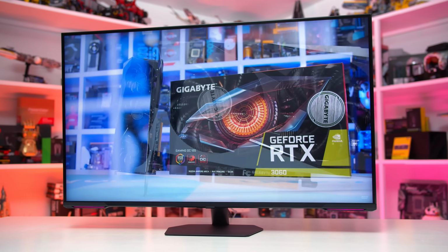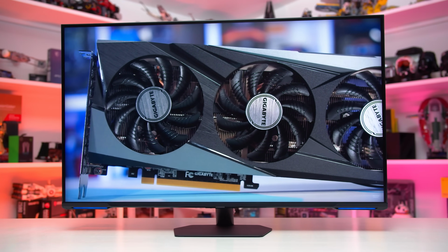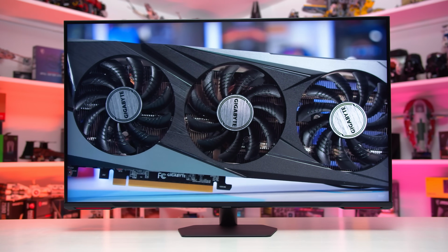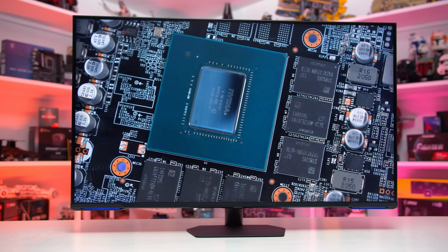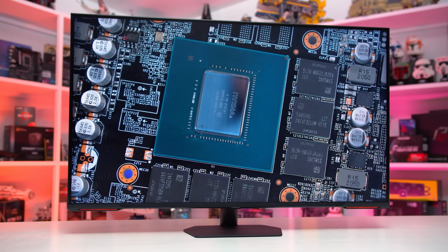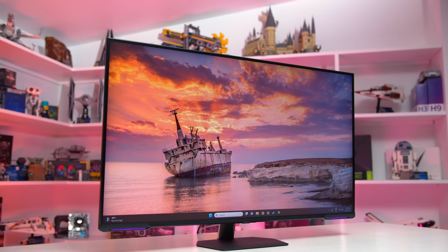The LS43 is much more usable as a monitor for desktop apps with 100% display scaling in comparison to WOLED panels at this size, so you can utilize the huge screen real estate with fewer artifacts. It's not perfect or ideal, as we're getting a BGR subpixel layout here instead of the traditional RGB, but at least BGR is somewhat correctable in software in Windows, and even without corrections, it looks far better than WOLED's RWBG or QD-OLED's Triangle RGB. Along with zero risk of burn-in, this makes an LCD like this a much better choice